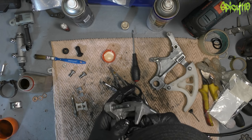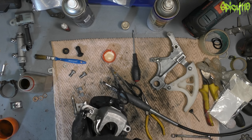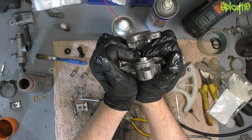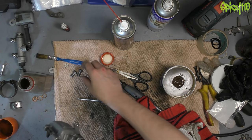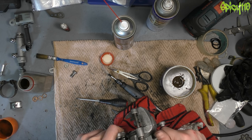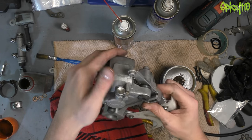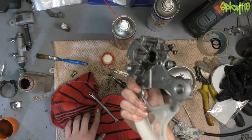What I've been doing with all the other bits that need cleaning up is just wire wheeling them and using WD-40 — and you've seen plenty of that, so I didn't think you'd want to see even more of it. One last clean with a bit of brake cleaner to make sure there's nothing in there. Temporarily putting the pin back in with a little bit of copper slip on that to make sure it doesn't seize in future. Stick the banjo bolt back in there just to protect it. One nicely cleaned up caliper, all serviced, free moving, and I've got the brake pads to put in there — another part done.